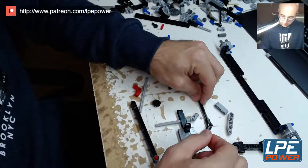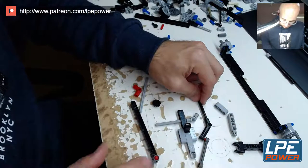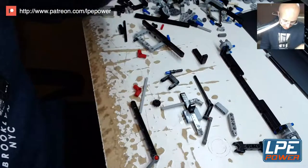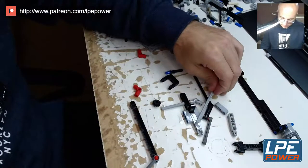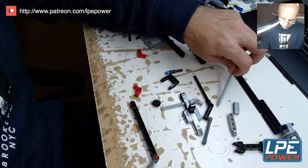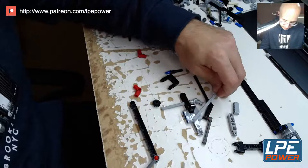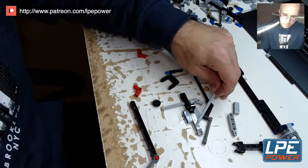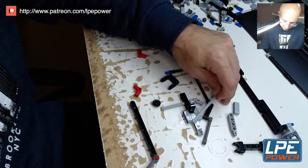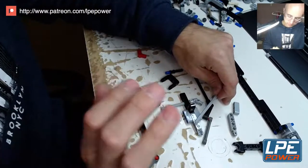Okay, then the anti-roll bar connects here to the suspension. So I'm just leaving it here. But then I need to triangulate this to the back somehow. I mean, to the back somewhere, preferably behind the anti-roll bar, or maybe into the same bracket that the anti-roll bar is going to sit in, just so when the jolt comes from the front, the arm cannot be pushed backwards.